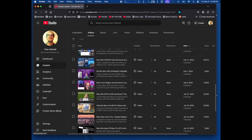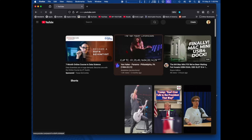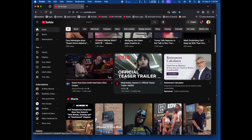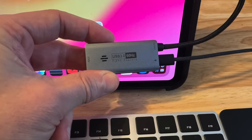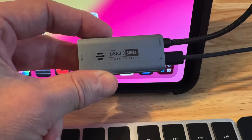You do need to have your Wi-Fi on and your Bluetooth on to get Sidecar working. You don't have to be on the internet, but you need your Wi-Fi network up and running and your iPad on the same Wi-Fi as the Mac Mini. The capture card also has a USB-C power input so you can charge your iPad while you're using it.